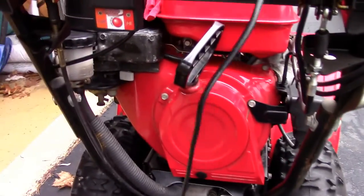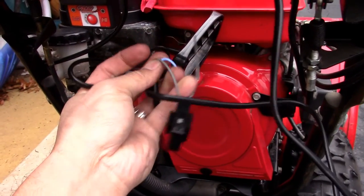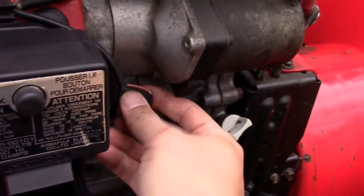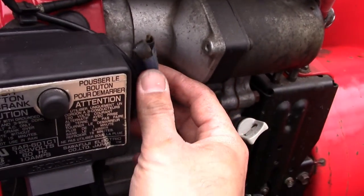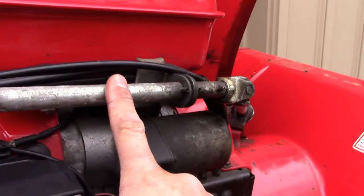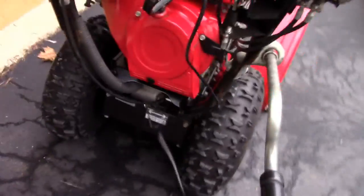And then the cable that goes to the battery, or I could use the light wire that comes off of the stator here, which is tucked away. You can see it here. This is actually for the light. I could use that, but I'm actually gonna run an auxiliary battery because I'm gonna do the electric motor chute, and I'm gonna encase it and plug all this in and get it all done in one shot.